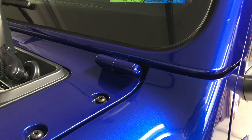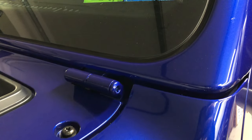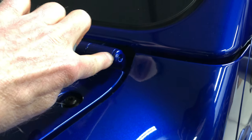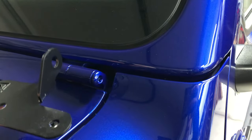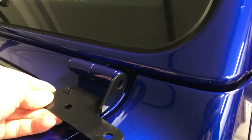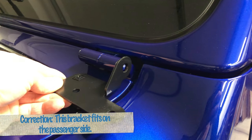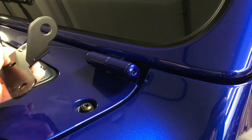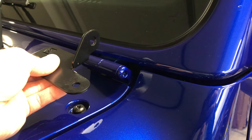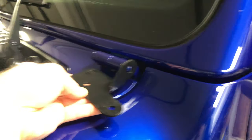This is the driver's side of my Jeep, and I picked up one of the brackets. You're going to be removing this bolt and also the windshield bolt. This bracket is going to bolt underneath those, and then you reinstall the hardware — that'll capture the bracket. The hole on the end is where you're going to mount the pod light, and it'll sit up on top of that bracket.